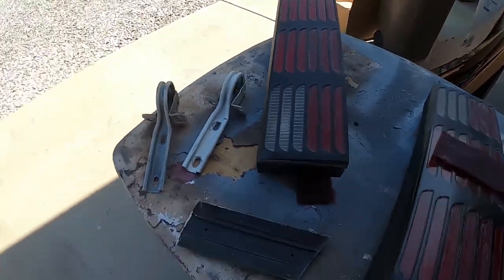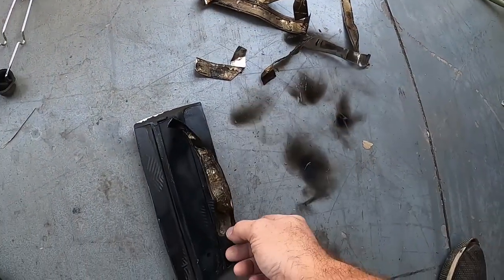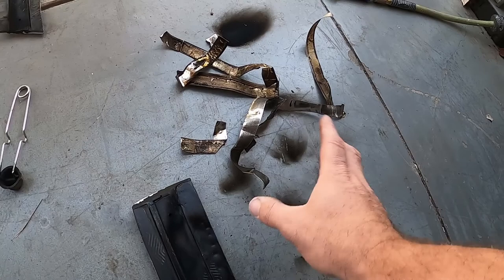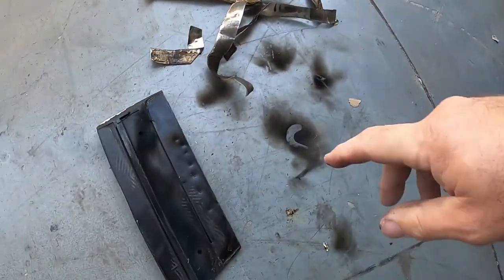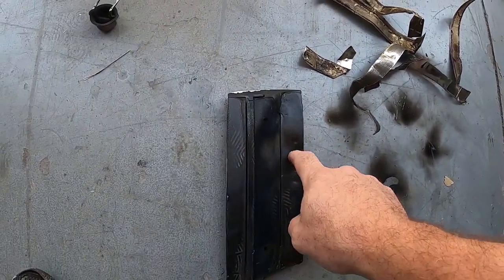The way you do that is you have these metal two-face tape things that are in here. I usually use a small torch, but I ended up having to use my acetylene torch, just set it really low on a welding tip. That's what I had to try to get it down. Now you can see where I pushed in with the screwdriver trying to pull this off.